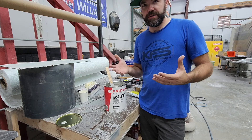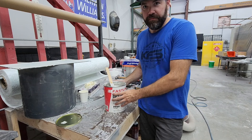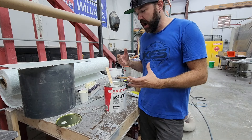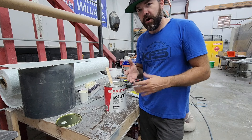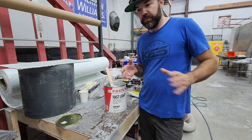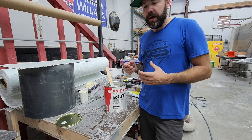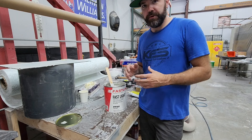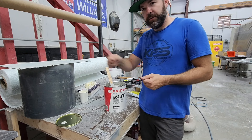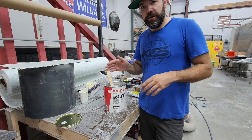When this comes from the factory, it's a pretty thick product, and that works great on vertical surfaces or on your first build-up coat. But when you start to get into your second or third coat, you really want it to be a little bit thinner and to kind of self-level, so that when you're done squeegeeing it out, it almost settles down on its own.